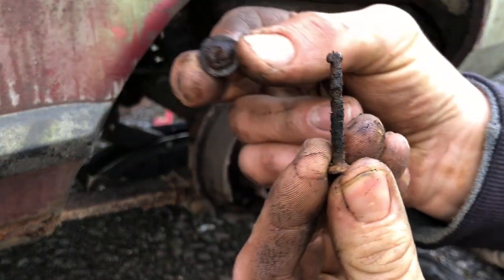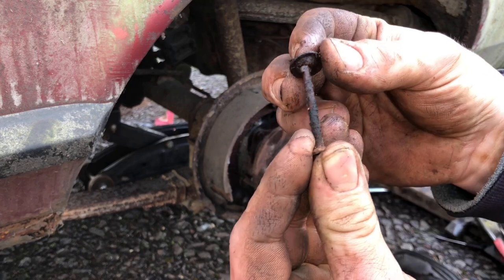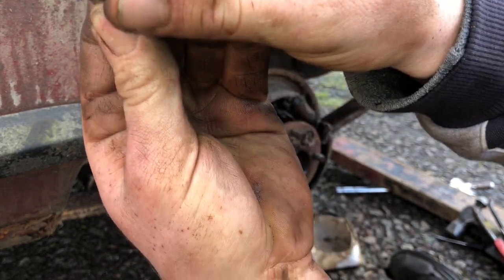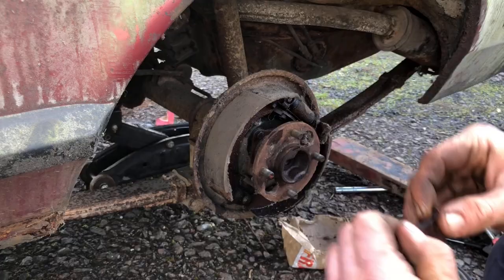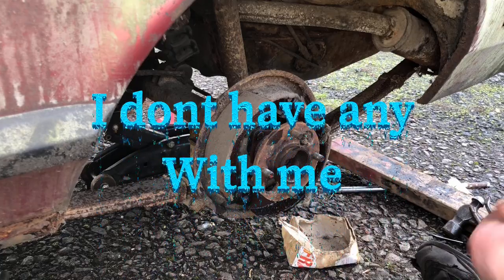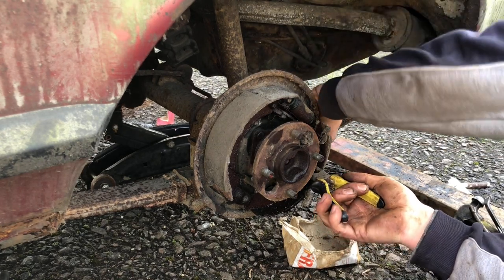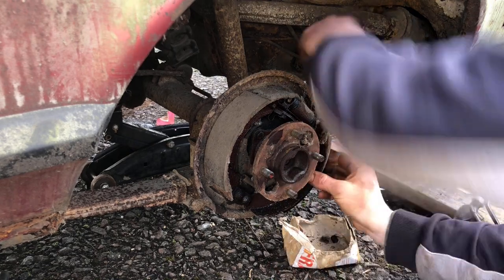T-shape, then see, I'm finding it hard to see the screen, so that's why I'm all over the place. You also have a T-bit in there. As you push in, you have to give it a bit of a wiggle because of the corrosion, then twist it so it sits in the dish and then it won't pull out. Got one of them each side. Keep them safe.